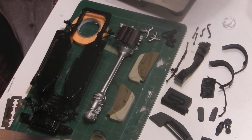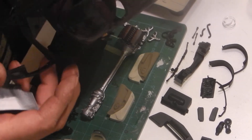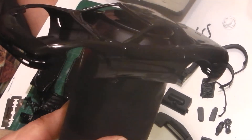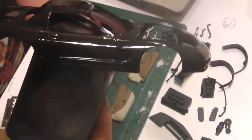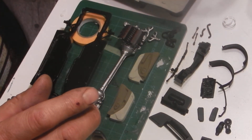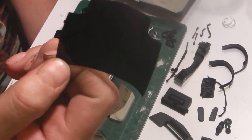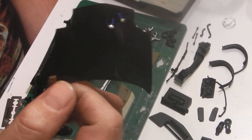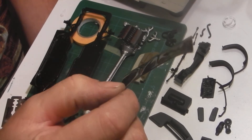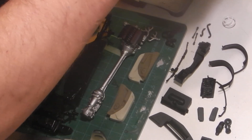I did get some paint on the body. Decided to go black with it. I originally sprayed it with red, but I made the mistake of using a really old can of red paint I had kicking around, and it didn't go on very well at all. So I stripped it and shot the black. There's a view of the hood - it's actually just black primer, clear coated. But it's turned out nice, so I'm happy with that. Still have to buff it out - there's a little orange peel in it, so I'll get that all buffed out and get it shined up.